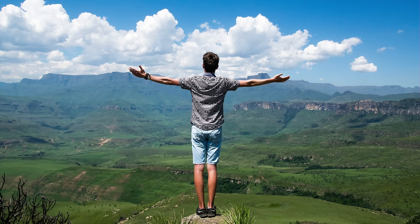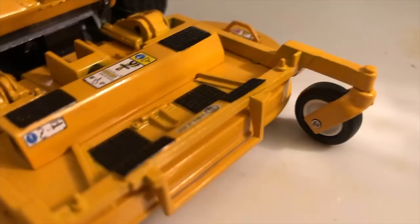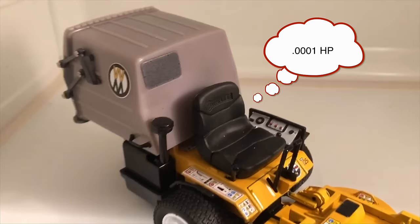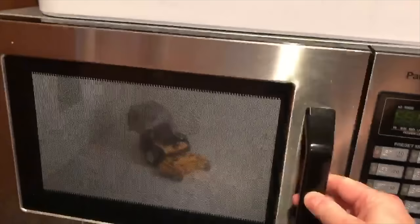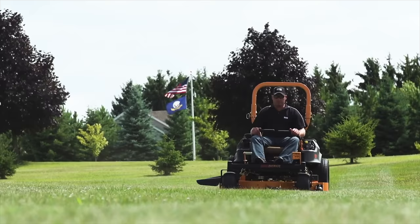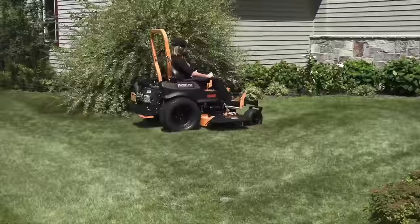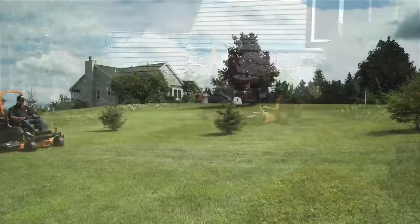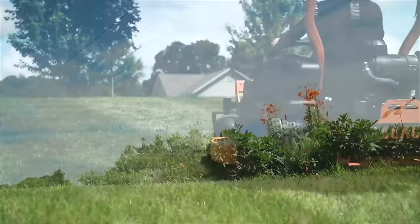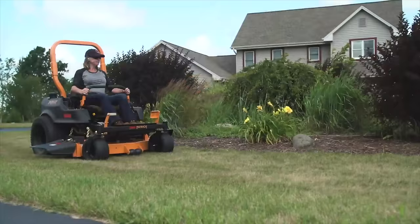You're also going to have speed because you can go very quickly, blasting those clippings right out. If the vacuum ability goes down, those blades won't stand up as straight and you won't get as good a cut. A small homeowner's lawnmower doesn't have a lot of horsepower, so adding a bagger or mulching takes away from cutting power and can reduce vacuum ability. But those side discharge benefits are also good for the homeowner — you'll get a lot of power from a smaller mower, an excellent quality of cut, and you can go very quickly.